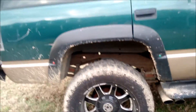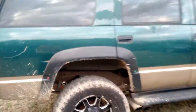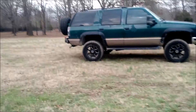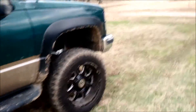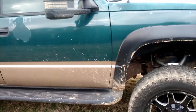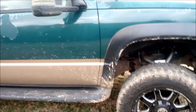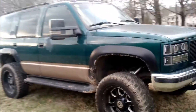This isn't my stock rear axle. The rear axle is out of a '99 Yukon Denali four-wheel drive because I converted from five-lug to six-lug. This is actually my stock five-lug axle — 3.42s with a G80. The Denali axle is actually 3.73s with a G80 also. I did the front conversion using 2500 light-duty rotors to get six-lug in the front. It could be something with my rear axle or one of my rotors — I didn't have that vibration when I was still five-lug with the 35s.